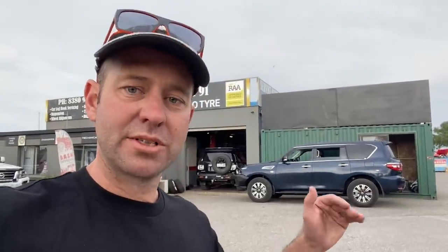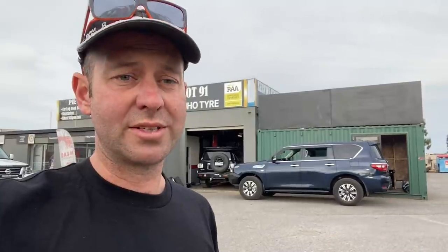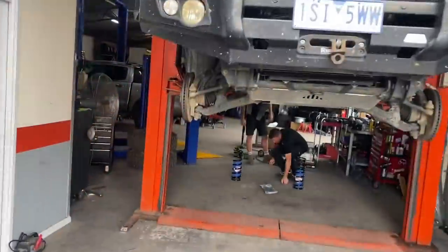The super heavy is for 400-plus kilos - that's like the full setup with bash plates, big fridge, long range tank, rear bar, sliders - everything you can put on there, basically all the GVM upgrades. For the 400 and 400-plus springs - heavy and super heavy - you also want the billet rear arms, because there's enough weight that you're going to start bending that lower control arm at the back. Once you put a rear bar on, it's a slippery slope. For GVM upgrades, it's different in every state - ask your local Y62 specialist.